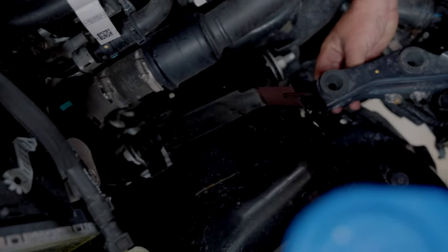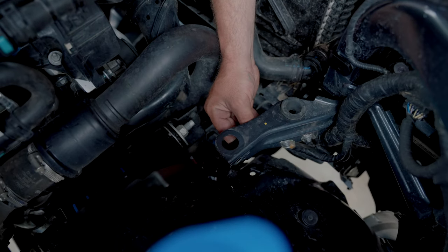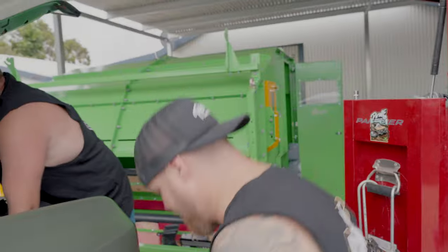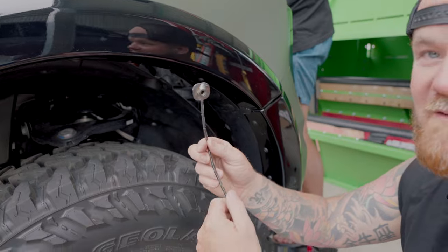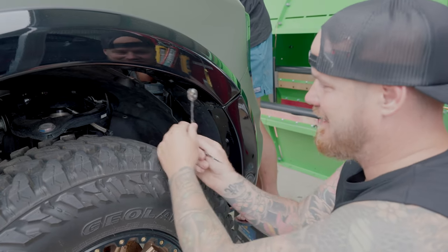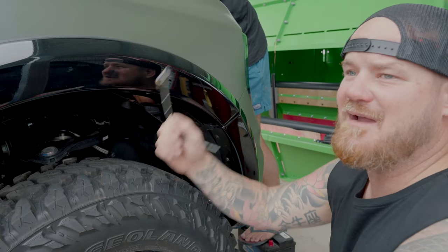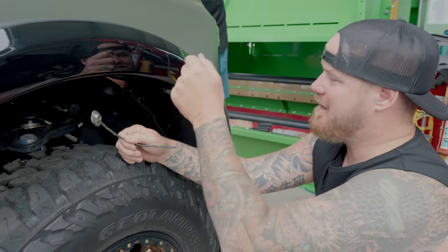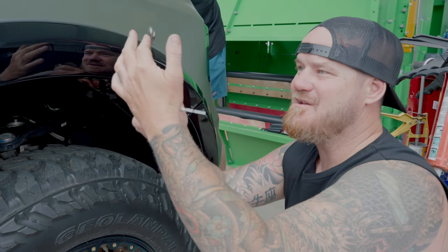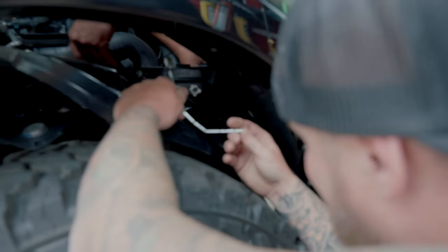Line up with that hole at the top. It also helps to pull this rubber inside out and put the bolt through that way. I actually didn't know that because I haven't put the bolts in yet. Right, so I'm going to start feeding this in. The easiest bolt to start with is this straight one. This bent one points back towards the radiator, goes up about so far, and it's closer to the front. We'll give you a bit longer bolt so your mate can poke it through while you feel for the captive nut from factory up there.